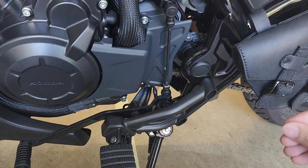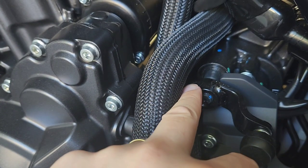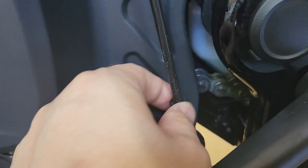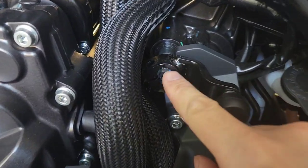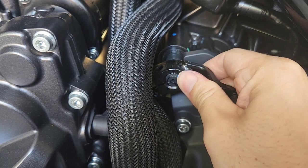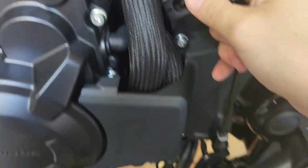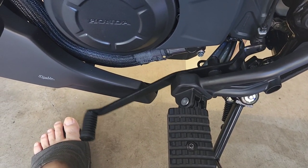When you undo those two, you can swivel this in an unlocking fashion and pull the rod out. The top bolt only has about a centimetre of thread — you loosen it up but can't keep winding as it'll run out of thread. Once you've got those two loose, you'll see this is like a spline, similar to a drive shaft on a car with teeth in it, so it doesn't slip. You can then loosen that off and pull it out.